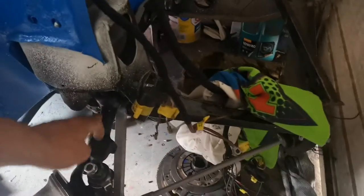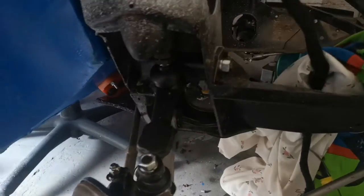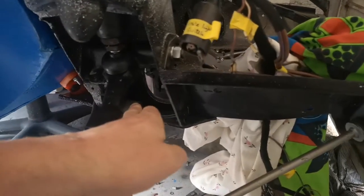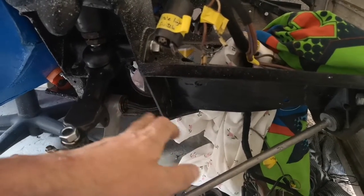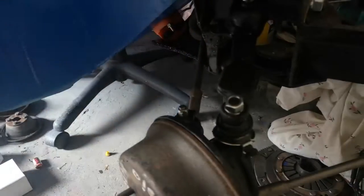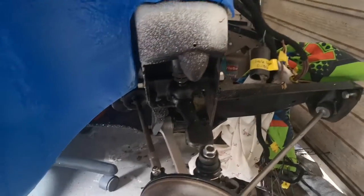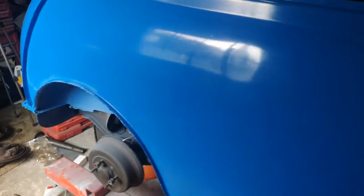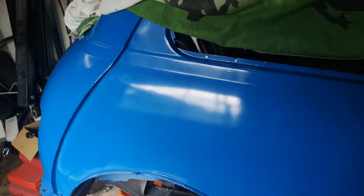So yeah, I've got the top arms rebuilt with new pins, new bearings in the top arm. I need the little bump stops to go under there. New bushes on the lower arm, recycled bolts, new bushes on the front arm, obviously new track rod ends, but I still need to get the lock nut, which I haven't got. I must have binned it rather foolishly. So yeah, things are looking well for the car. I've got the front end built up. My good friend Mr. Hart gave me some high-lows, so I've got the front end in there with some cones, as you can see. But I appear to have lost my cones for the rear of the car, which is annoying, because if I knew where they were, I could fit the rear high-lows and put it on its wheels.